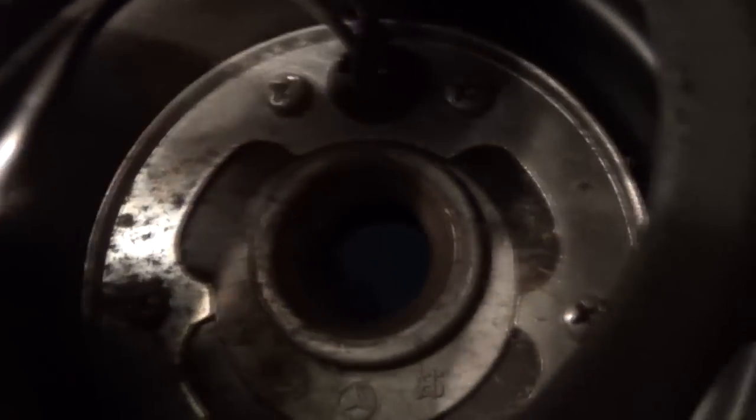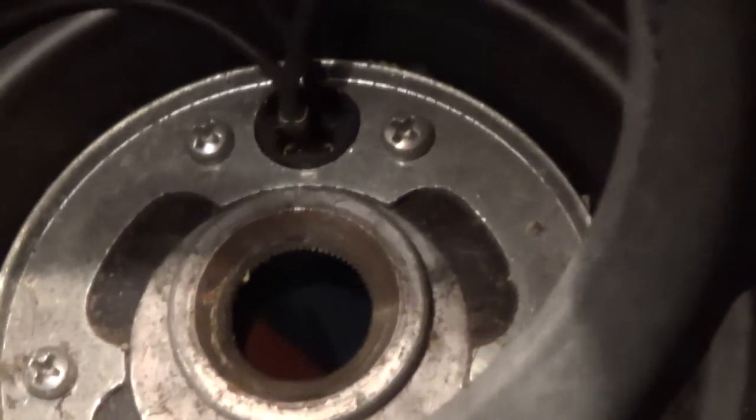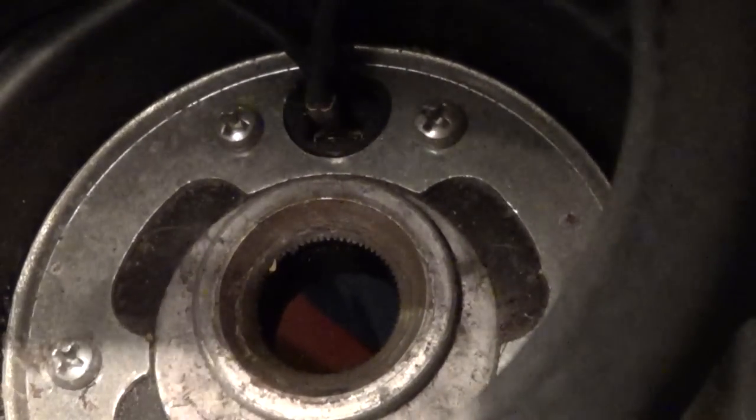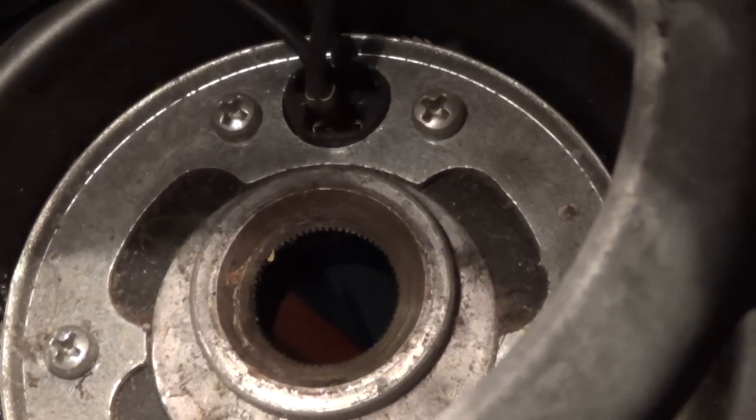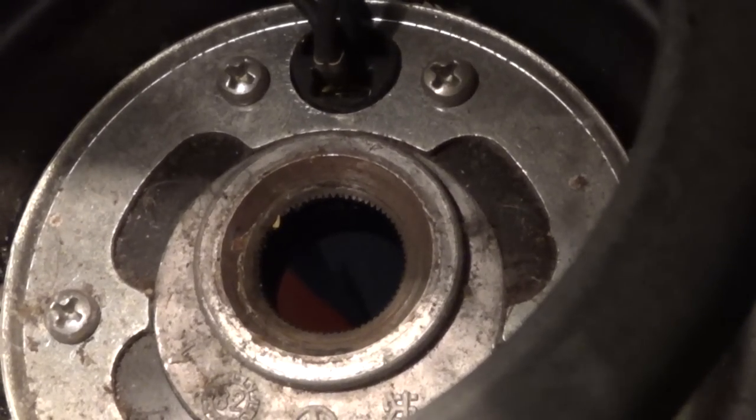Let me show you the 83 steering wheel for contrast. I'm just holding it in my lap — this here is the 83 steering wheel, and I'm trying to get light in here to show you. You can see there are splines there, but for lack of perhaps the proper term, that area in the center is dished or dish-shaped to accept the bolt. The bolt just sits in there, you can see the edge, and that's how the 83 steering wheel is attached. So even though the splines are the same, the 79 steering wheel just does not fit properly with that same bolt.